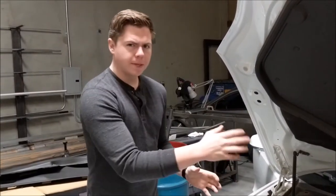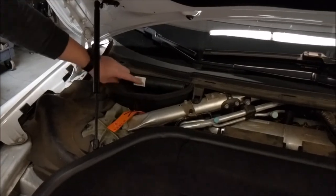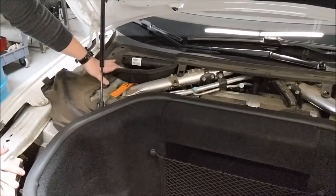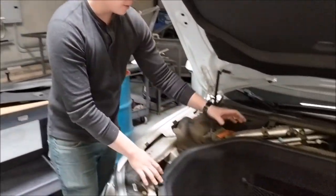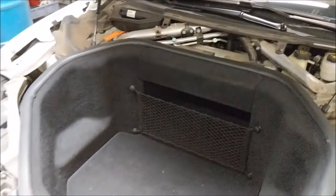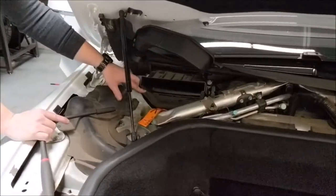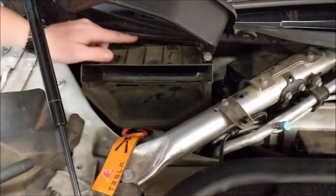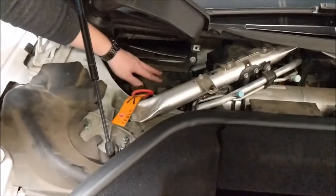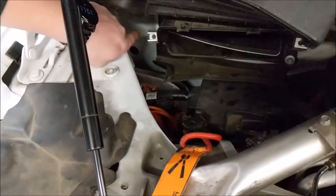Once you have those three pieces removed, you're going to have to find your battery. This is before the refresh, non-dual, so our battery is located right under the air filter. You're going to take your air filter out — there are mushroom clips under the grommets that allow you to gain access to the battery. If you have a later version, you can find your battery right under these fuse boxes — you'll need to remove one more piece of trim and some air filter to gain access to it. There are two 10mm bolts located on either side and two clips on top of the air box. Once you pull that out, the battery is right underneath. Here's your positive side and there's your negative terminal. There's also one grommet right up here in the corner that you can use for passing your cables through.